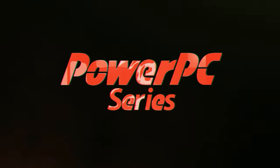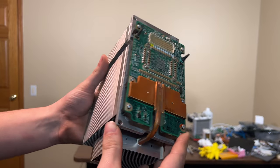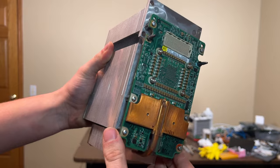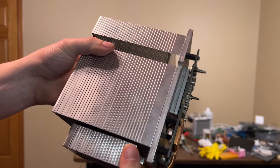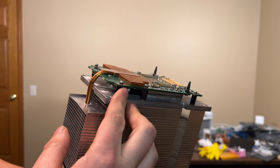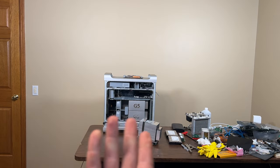It's alive! So before I even start filming, I noticed something. Last time I cleaned these CPUs, I did a horrible job at it, and they are actually corroding themselves again, which means I didn't neutralize all the Dex-Cool on them. They may not work at all now. You can see a lot of corrosion. This is the best looking one, though. This is probably the one that worked. I should probably clean it first, but maybe we should just roll the dice and see what happens. Probably a bad idea, but let's just clip it in there and find out.